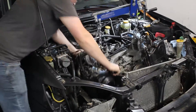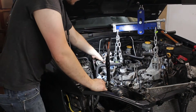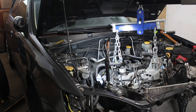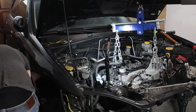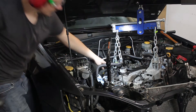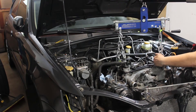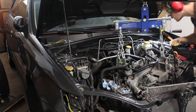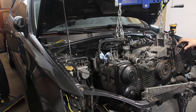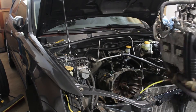This worked to separate one side of the engine, but there was still the other side I couldn't get to. I decided to remove the turbo so I could get better access to that side. With the turbo out, I could wedge a crowbar into that side of the seam, which finally popped the engine apart from the transmission. I was able to separate the engine — I did have the transmission supported by a jack stand below, but it did take a small fall. Thankfully nothing was damaged. I lifted the engine up out of the engine bay and thankfully had enough space to get it over the core support.